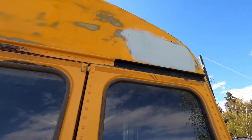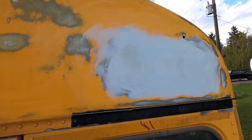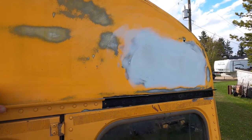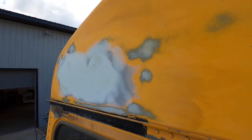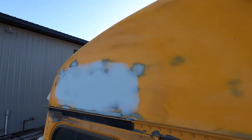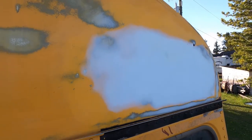We'll sand that and maybe have to do a wee little bit again, but it's close. There's sanded after the second coat — you can see it's a little bit low right here still, but we're getting close. Little light coats means less sanding between coats. One more and we should be done. There's the other side — looks pretty good. There's sanded after the third coat — she's ready for primer and paint now. She's all smooth. Worked out good.